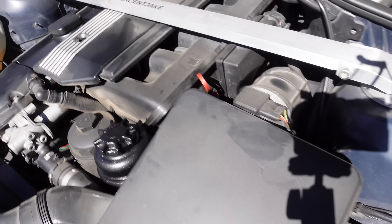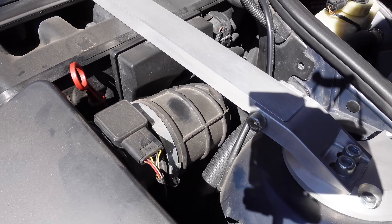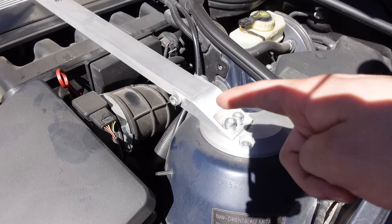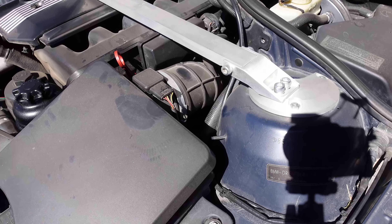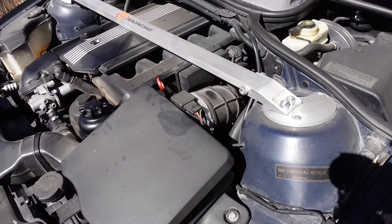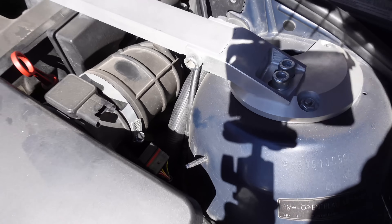How on earth did this get so dusty? Today we're going to replace the upper and lower intake boots. We're going to inspect the DISA in the process, because it has to come out. We're also going to remove and clean the idle air control valve, which needs done on most cars. The day the Mazda blew up, I was cleaning the throttle body — it doesn't have an idle air control valve, it just uses the throttle body, and it got gunked up. Let's get some tools together and start fixening.